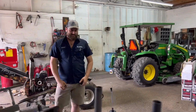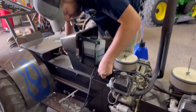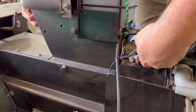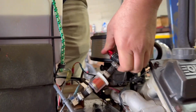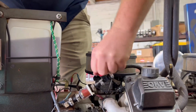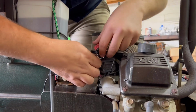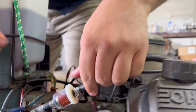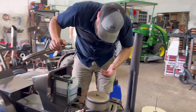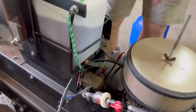That is sick. So right off the rip, we got problems. It's leaking fuel. Look at it. I don't know, oh, it's coming from right there. We may have to replace some fuel lines. I don't know if it's cracked somewhere or what. So we're going to have to find some of these issues because it's got fuel leaking all over next to this fuel pump here. We're going to have to drain the fuel out of this thing.